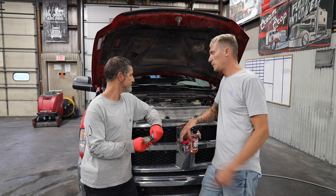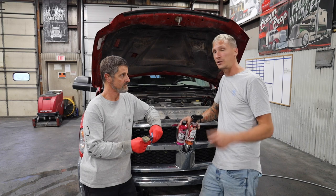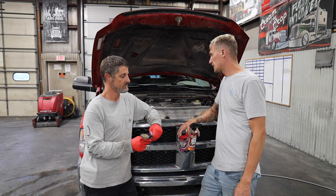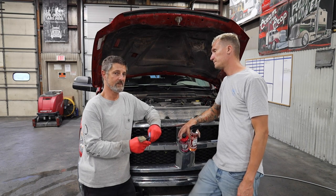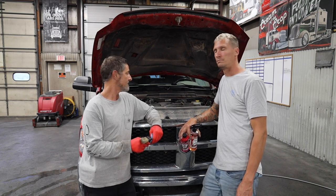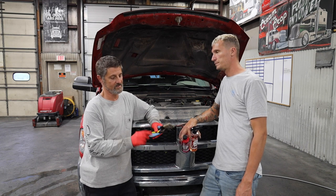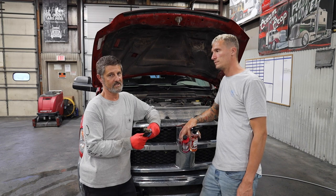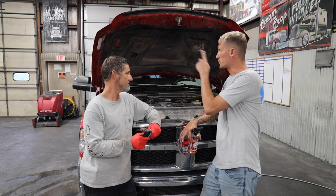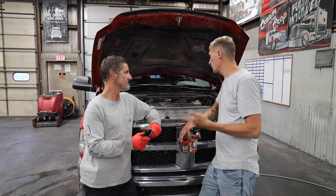Paul does a lot of fleet stuff. So what we actually did is we took our regular Time to Shine degreaser and put it in a pump-up sprayer. I'm going to run over and grab that in a minute here. And do you usually rinse first? Yeah, we're going to rinse the motor. I'll get 75-80% of the dirt off. Then we'll spray the degreaser on there, show you how I emulsify it. I got brushes, sponge. Then we'll do another rinse, and then we'll go from there. So while you start rinsing and talk about what you're rinsing, I'll go grab that pump-up sprayer and get that all pumped up and ready to go. And as soon as you get it wet, I'll start spraying for you.